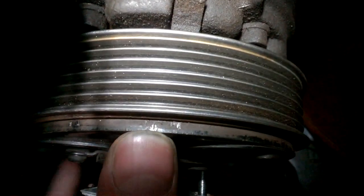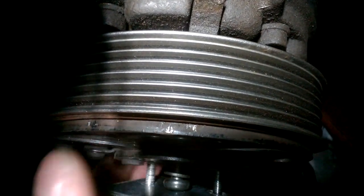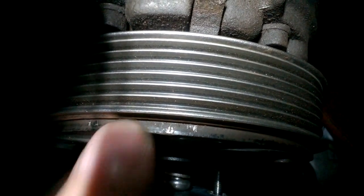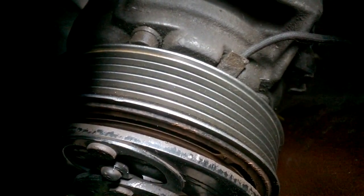I just hammered the clutch plate back in. The gap is too small — not exactly obvious in the image but I believe it's too small. I'll remove it back and probably put back the thicker shim and remove the two thinner ones. So I left only the thicker shim inside and removed the two thinner ones. Let's hammer this back in place and see how it goes.